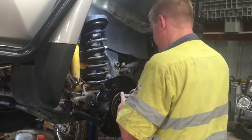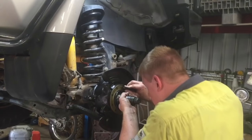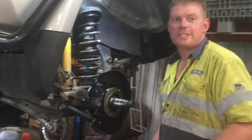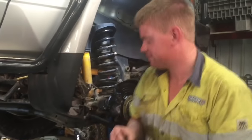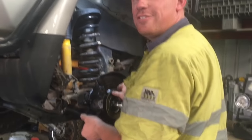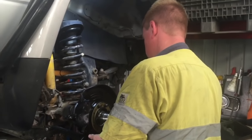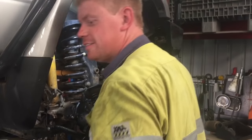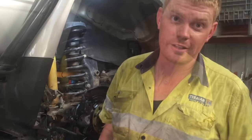Some of these will only go in a certain way where the flats are. Always make sure it's locked into the diff. Now we'll get the spindle sorted out. I'm just getting some grease and rolling it back into those needle rollers in the bottom of the spindle. Also put some grease around this brass bush, because that actually applies pressure to the inner face of that CV joint. Now we'll put our gasket in and throw the spindle back on.